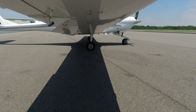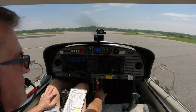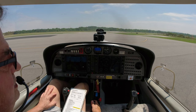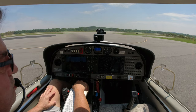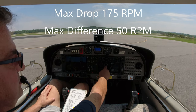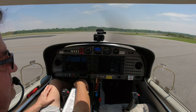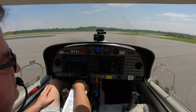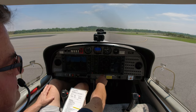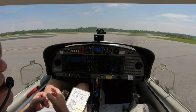We cycle the prop three times and wait for the RPM drop. Then we check the left mag — about 100 RPM drop; max allowed drop is 175, max difference between the two mags is 50 RPM. Back to both, then over to right mag — settles at about 1,920 RPM, so 10 to 20 RPM difference between mags — that all checks out. Back to both, and one last look to make sure everything's in the green: oil pressure, fuel pressure, fuel flow — all good. Pre-flight through run-up is complete. We are ready to go flying and have fun.